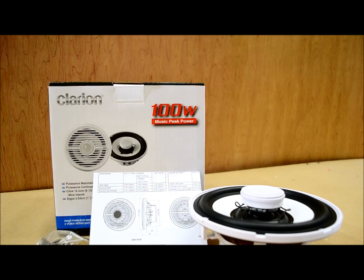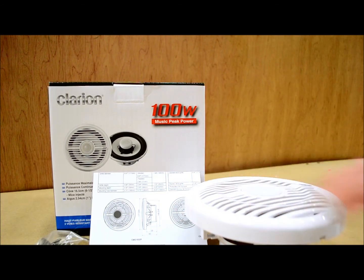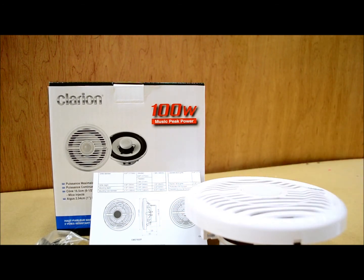These will handle 40 watts RMS — I won't waste your time with peak readings, because it's meaningless. At 40 watts on the water, it's not going to break your eardrums, especially if you're moving 30 miles an hour or better. But for an inside cabin or a moderate sound system without an amplifier or with a smaller amplifier, these would definitely do the job. And they'll last — I like the way they're built; the basket, grills, everything built to last. They're actually not junky in that respect.